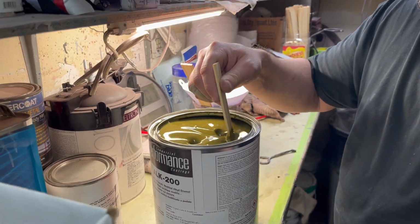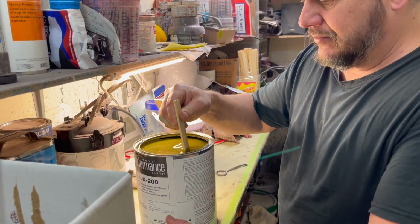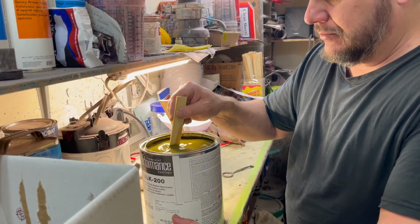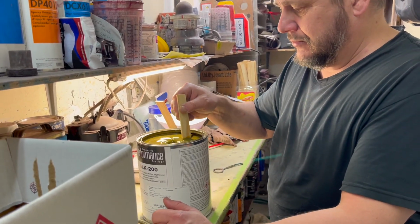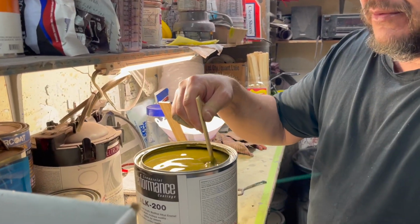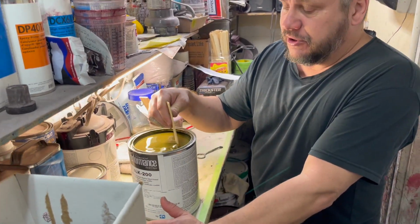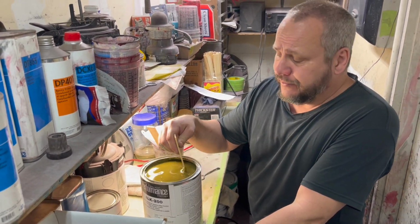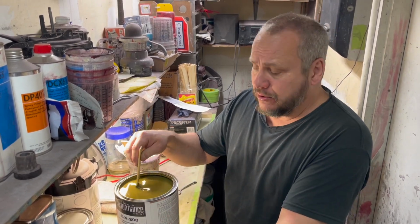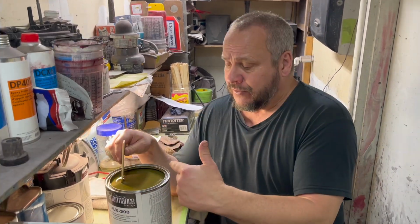All right, Barry, so this is kind of an unusual paint. You may have touched on it earlier, but it is a single stage, not base clear. It's a matte finish, and it's wet on wet, is what you called it, where you're spraying it pretty quickly after a primer. The primer we used is a PPG epoxy primer, and typically you have to give it about an hour to breathe and let some of the solvents get pulled out through your exhaust system.